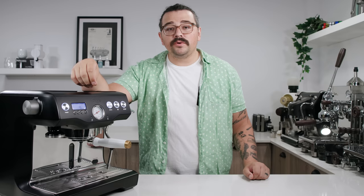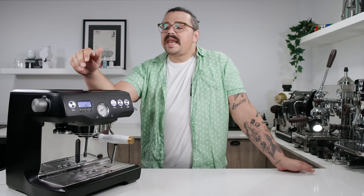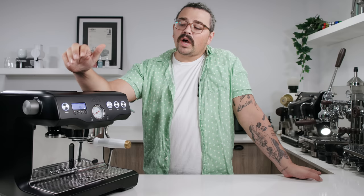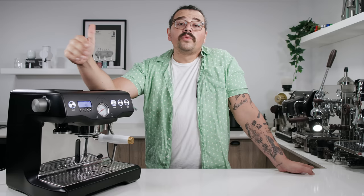Now, Breville actually has a patented technology that is using essentially a potentiometer to regulate the flow coming out for this pre-infusion. They do have it limited to the controls on the menu and just for that pre-infusion phase. A lot of people have found ways of doing what's called the Slayer modification, which I show in my first video linked previously, where you take the needle valve from the hot water spigot, you disable the hot water spigot, rerouting the water through the hot water so that you can have that needle to control the flow rate to the group head. Of course, that is a great way of controlling the flow rate.